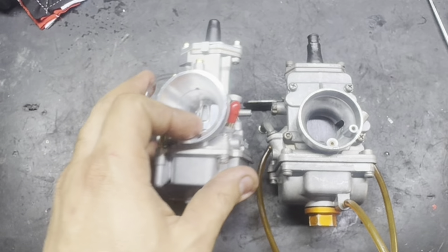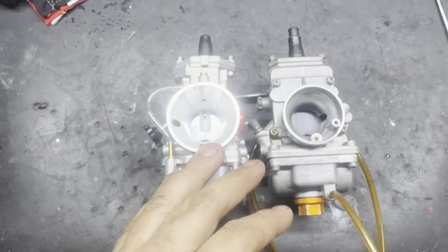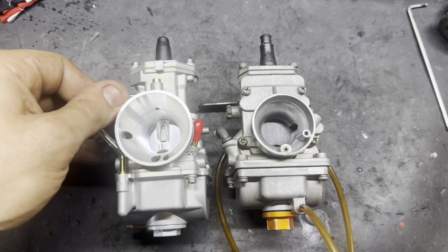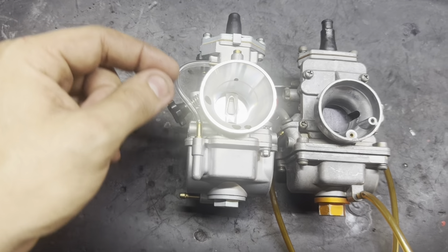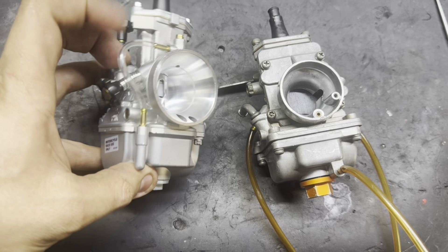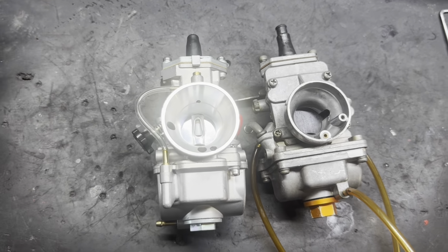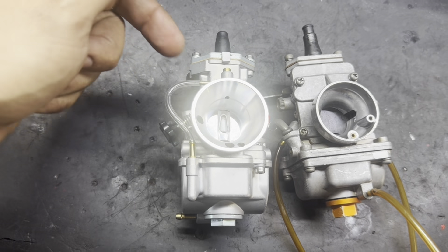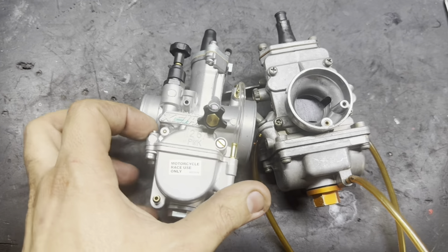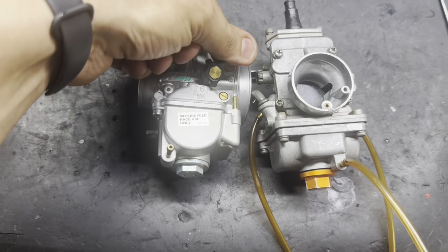V-Power Racing is not available all over Brazil yet, only in some places, and costs around R$11.00 per liter depending on the region. It's a good gasoline for tuning. We use 70% V-Power and 30% AVGAS — that is, aviation gasoline, not kerosene. Many will ask about the Powerjet — for me it's worthless. I'll isolate it on both sides. It gives no power. When you properly tune your carburetor at low, mid, and high range, you don't need the Powerjet. Anything extra it injects will over-richen my mixture and the bike won't run well.